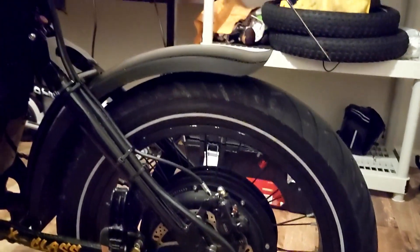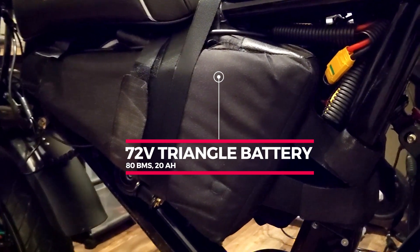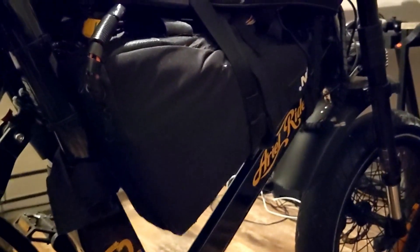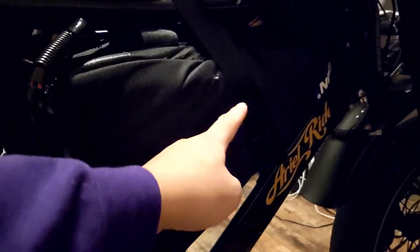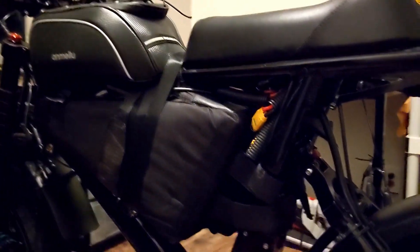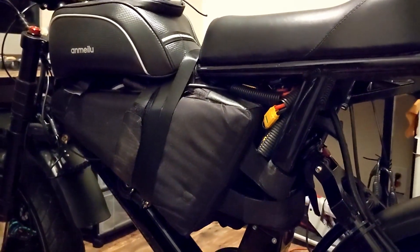Powering the motor we have a 72 volt 20 amp battery — actually two 72 volt 20 amp batteries, which total about 40 amps. They're sitting in their triangle battery bags, sort of next to each other. Forgive the janky setup — I do have a ratchet strap holding them together, but I plan on getting a bigger bag to house both. In there is a Daly X 90 amp battery blender connecting both batteries together so they work in conjunction.